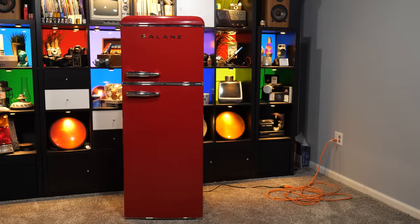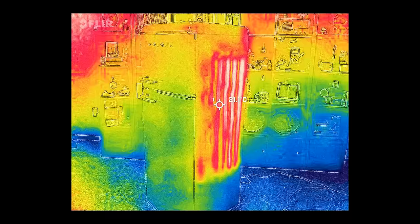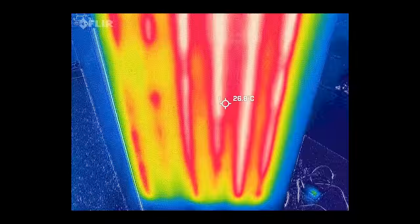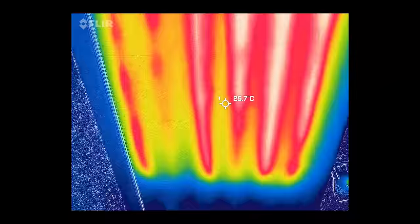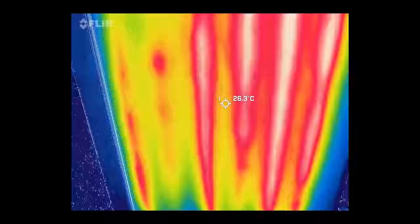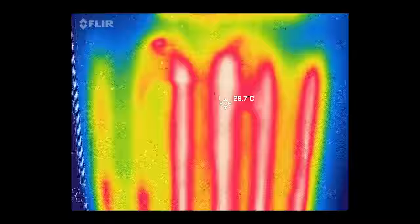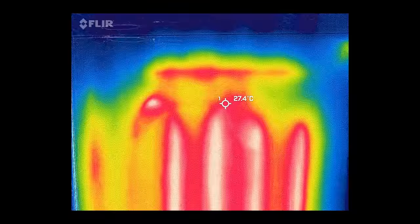Well, it turns out that this thing is built like a chest freezer. When the compressor is running, it squeezes gaseous refrigerant into a long snake of a tube that travels up and down the sides of the fridge body, directly beneath its plastic skin. Since it's under high pressure inside that tube, the refrigerant's boiling point has increased and it wants to condense into a liquid. It will slowly but surely give off heat as it condenses, which causes the sides of the fridge to get warm, and eventually that heat is dissipated to the surrounding air.